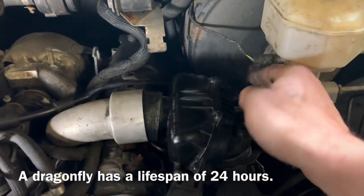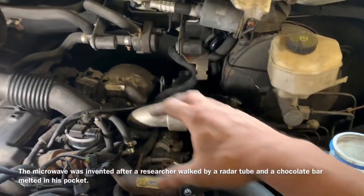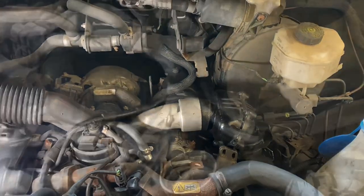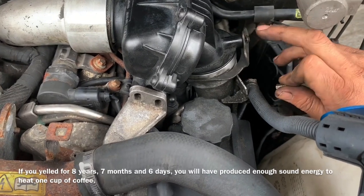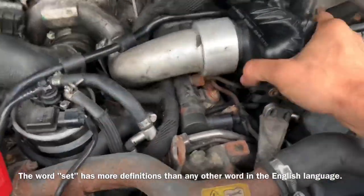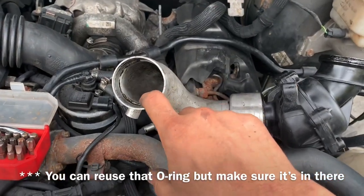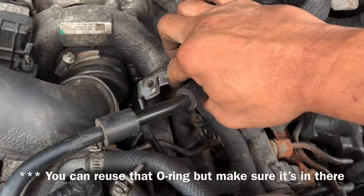This is what happens when you don't stick that screw back in — it goes on the side here to anchor this down, because the turbo boost is so great it blows the piping apart. Same will happen if you don't put that O-ring down inside there either. When this sits inside there it sits behind that post. The screw that secures the U-clamp is a Torx T15. With that screw removed we can wiggle this and pull it up out of the way. It may not be necessary to remove all of this but I'm doing it for the video just in case. When you pull this housing off there's going to be an O-ring either here or located on the end of the turbo — make sure you replace that when you reinstall it.